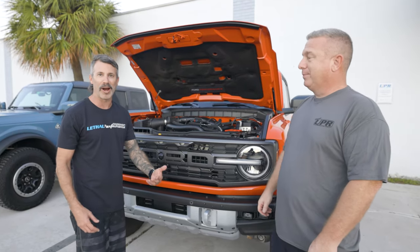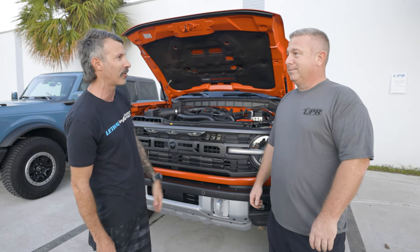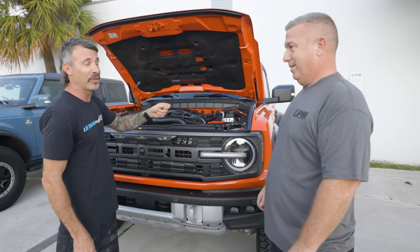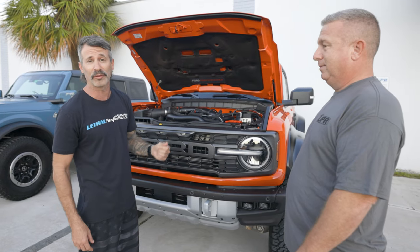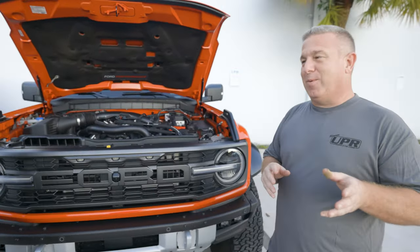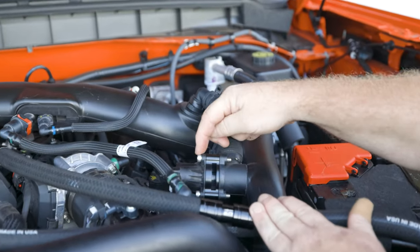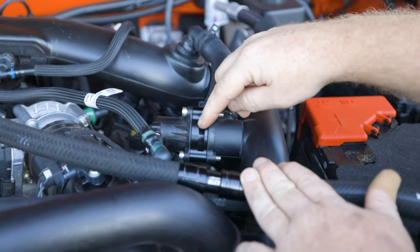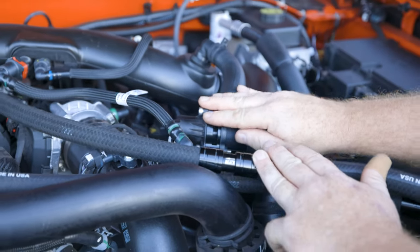It's so good to come down here and pave the way for the Bronco Raptor owners and community, and work with these guys. Steve, the catch can man, is always so informative. We're going to have some pretty cool instructions available for that special fitting with the pick. That's why it's a little more in-depth installing the dual valve catch can — we'll have that on the website. And there are a couple other goodies on here. We've got the blow-off valve adapter. The UPR blow-off valve adapter is so easy to install — we include hardware that threads directly into the factory nut, you put the spacer in, put your blow-off valve back on, use the UPR stainless hardware to thread back in. It's about a five-minute install.